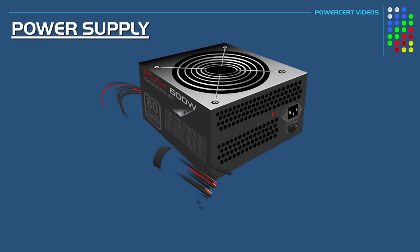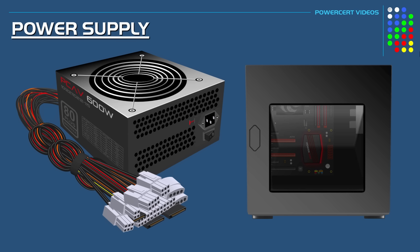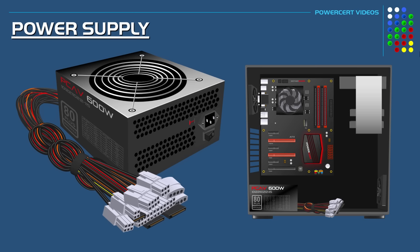The power supply is a square metal box with a bunch of wires emerging from one end with connectors that fits inside the computer case. And it's usually located at the very top or the very bottom of a standard tower case. Power supplies also come in different shapes and sizes and mounting bolt patterns, which is known as the form factor. And the most common form factor that a power supply comes in is ATX.